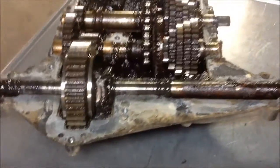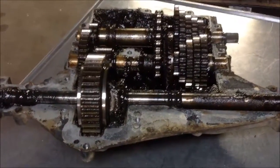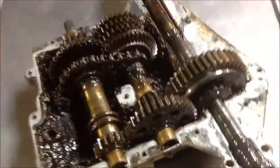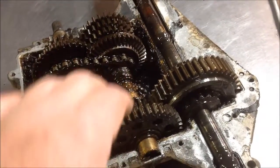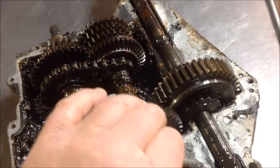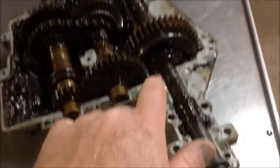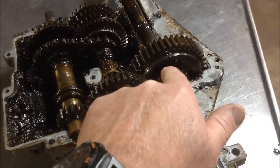So anyway, I think that's about all I've got. So I'll clean this up, and what I will do is I won't tear all the grease out of it. There's no need. I will take some rags and cover all of this here, and I'll tuck it down in, and then what I'll do is probably put some cardboard over the top of that, and then once I get this set up, I'll just reach in with my arc rod and put a tack there, and then I'll put a tack on the other side. That way it can stay.